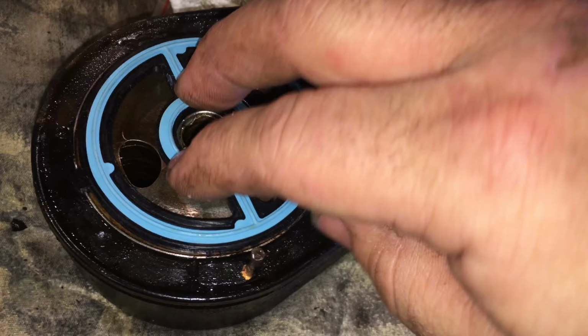Okay, so here you can get an idea how I clean up the surfaces. They're quite clean now. I use a combination of a little bit of rubbing alcohol, some paper towels, a little sandpaper for the harder stuff. I even used a wire brush, die grinder to clean also. Be careful, you don't want to take away too much material, but you want to make sure that there's no grime. And then I hit it with alcohol again one last time to make sure that there was no actual grease or anything else like that. You can use other things like brake clean, and so on. Just make sure you don't spill a lot inside here where it would stay there, because you don't really want that in your oil. But whatever you use, make sure it comes back off.